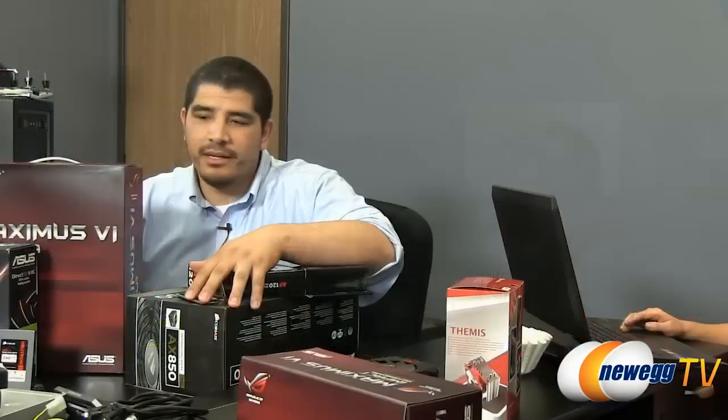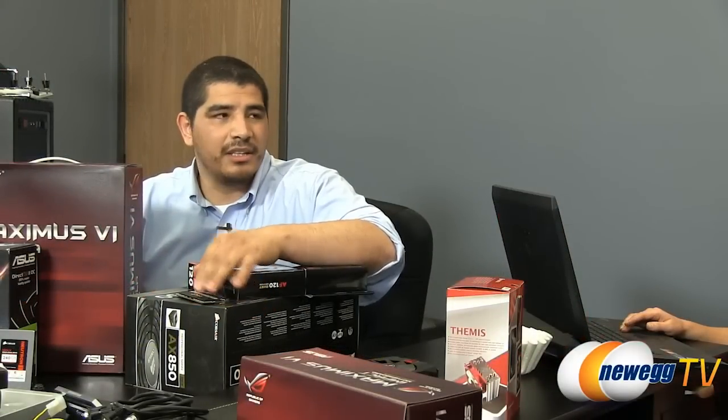But what I tell people is just be precautionary, take a little bit of sensibility. So regardless of where you are, just be mindful of that. Make sure to ground yourself beforehand, and more often than not, you're going to be okay. But it is something that regardless of wherever you're building, always keep it in mind. Yeah, the best way to do static discharge is to have a power supply that's powered off but plugged into the wall. Touching the chassis of that should static discharge you.